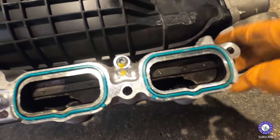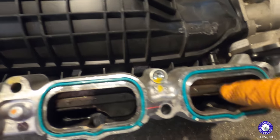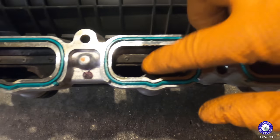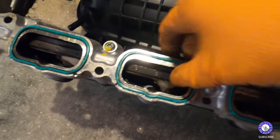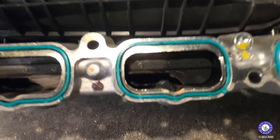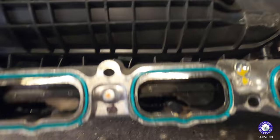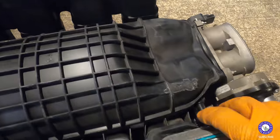But let me show you the other intake as well, which my car, it's an 05, and it only has about 40,000 miles on it. The charge motion plates here, you can see that there's a lot of carbon buildup on them. I wouldn't think they'd be that much. Maybe that's not that much, I don't know. But seems like a good bit. I guess it don't matter. You know, you got gas and oxygen and all that good stuff coming through there, but that's all right. The new intake's gonna take these charge motion plates off and it's just gonna be rocking and rolling.